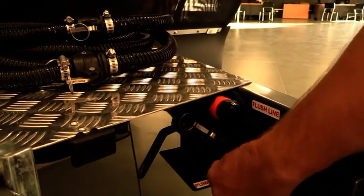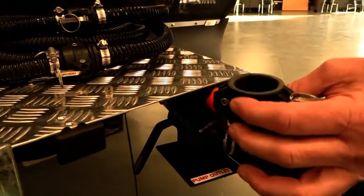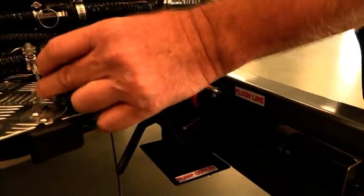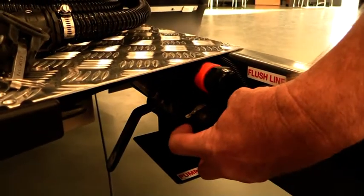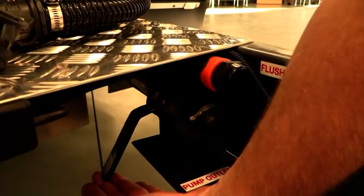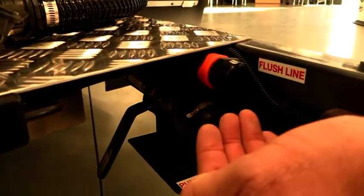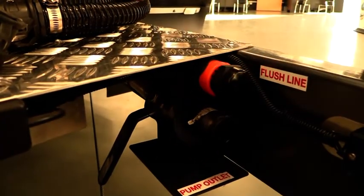Simple operation. This is only a dust cover that we've got on here, so we take off the two little levers on there — that's just a little bit of water coming out. We would connect the hose directly onto that fitting there. Then we've got a lever up underneath here; I would pull that towards me. Once that hose is connected, that is an open line now from our black tank.